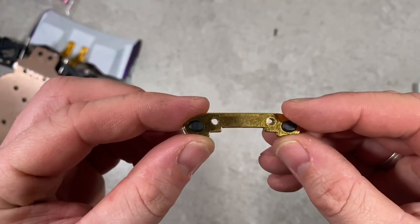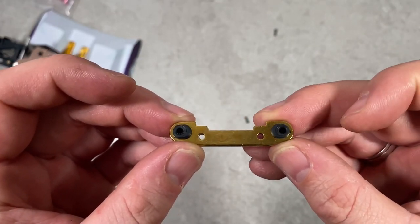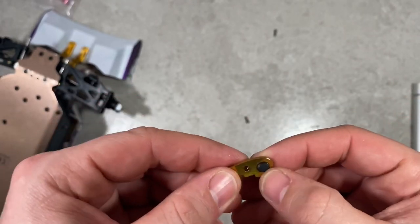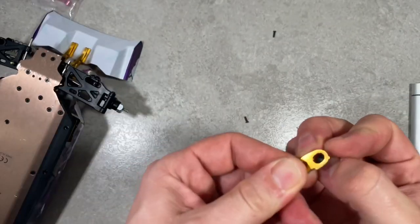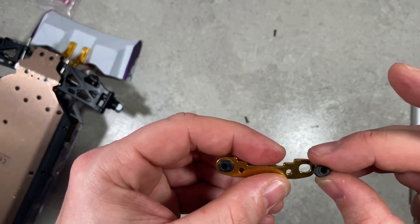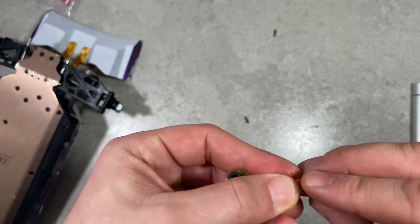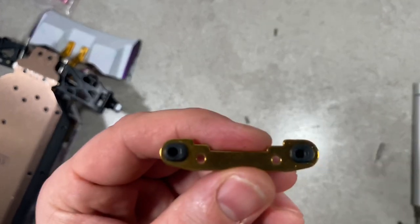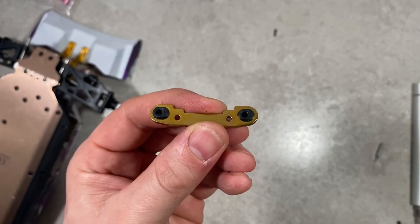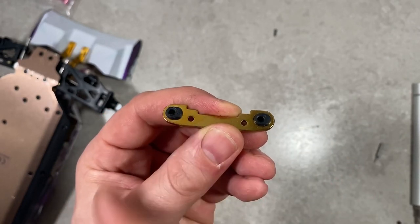Let's slow back to normal speed. You only need to swap the plastic inlays that hold the rods — twist them around from one side to the other, exactly like this, so they're facing to the inside. And that's it — we're done. Now our wheels are straight in the rear.